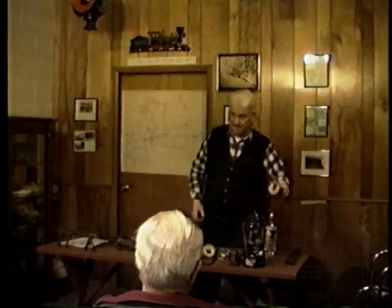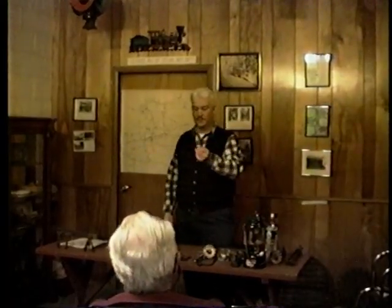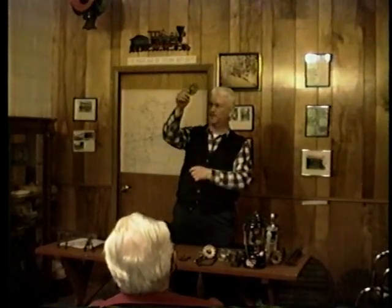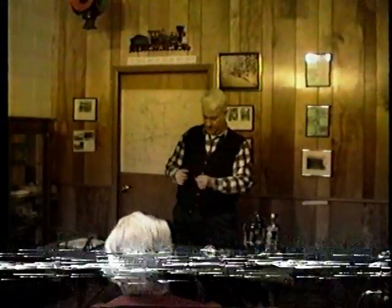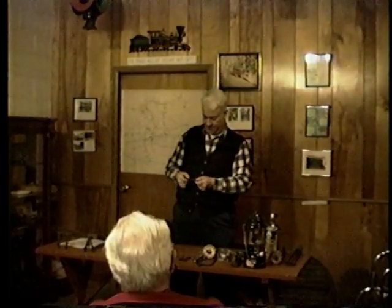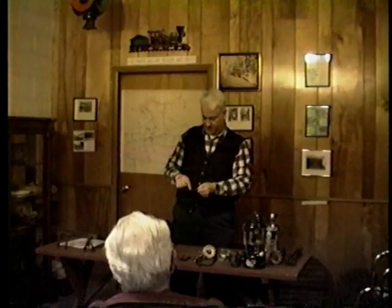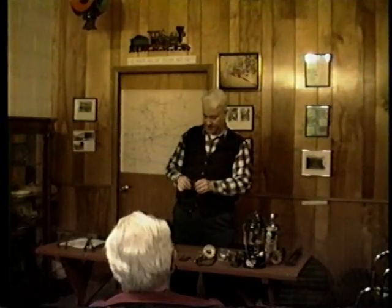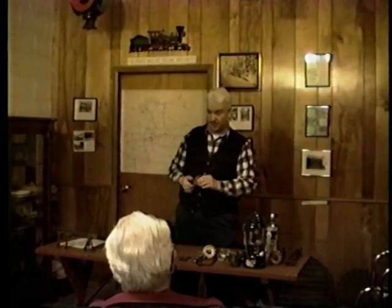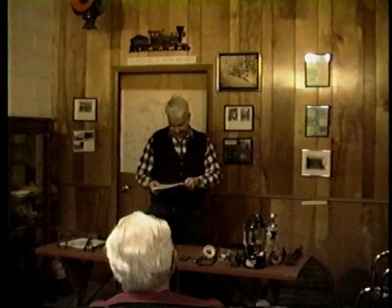Sounds like there's a dwindling supply of parts. Here's one of the diaphragms, which really is a piece of brass. This is probably a bad one. They get cracked, but that's really what does the work inside there. And although it seems easy to move with no bolts around it, when you get that all bolted in there, it's a pretty tough thing to do. But that's what the steam does, is move that enough to shut the valve at the other end.